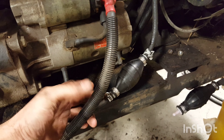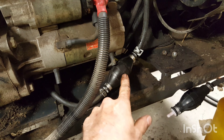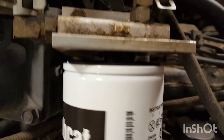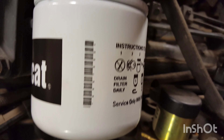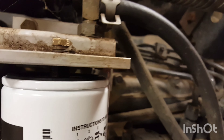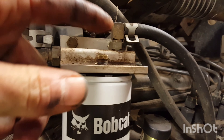Let's see if it works. I got the new pickup tube in there — ended up going with an even 36 inches of tube. New bulb — there's an arrow on it, make sure you know which way it goes. The arrow should point up toward the pump. Got the new filter on. Let's prime it — just grab your primer bulb and start squeezing. We'll see if we can get some fuel coming out. Oh yeah — there we go! That's a good sign.